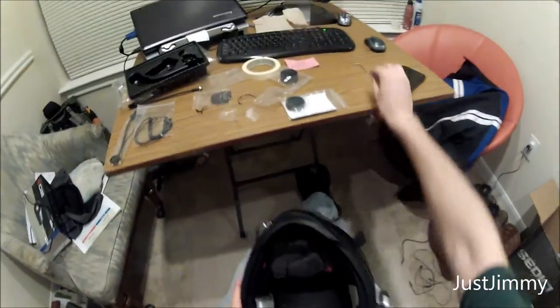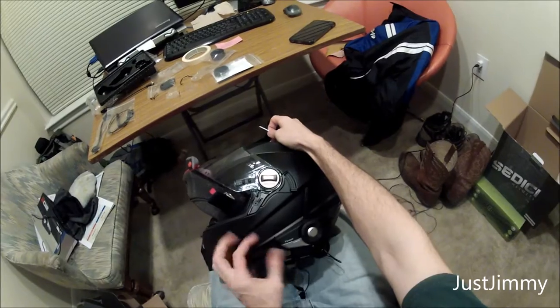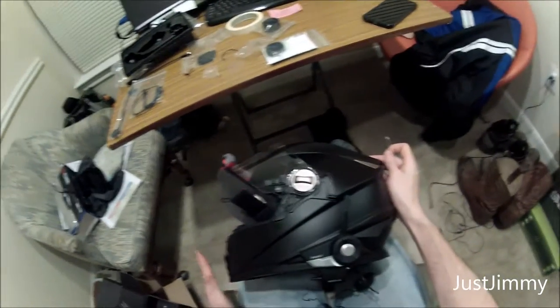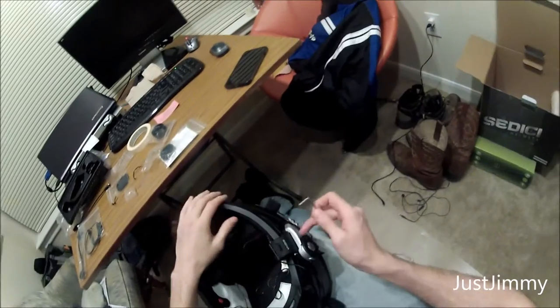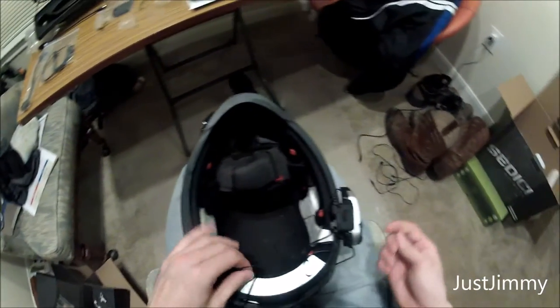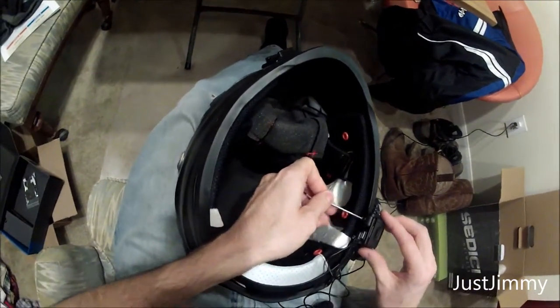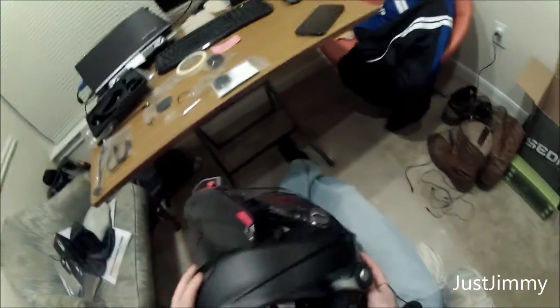I wore the helmet for a bit and looked at some pictures on the internet of where most people wear theirs. Most people wear theirs a little bit further forward, kind of right underneath this bracket here, but I like mine a little further back. One, because I kind of like the idea of it following the lines of the helmet, and two, I like the idea of the wind being buffeted more before it actually reaches the mic. Three, most importantly, I felt I'm able to comfortably twist my arm back at an angle and still reach it. So having done that, I'm going to keep the cables out of the way and go ahead and tighten these up. That should be a good solid mount at this point.